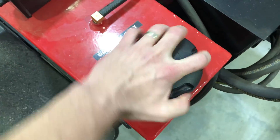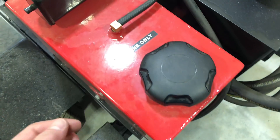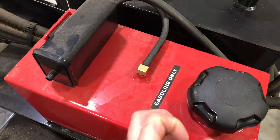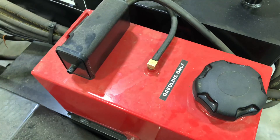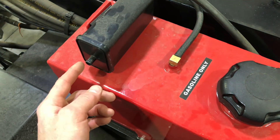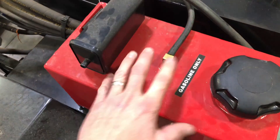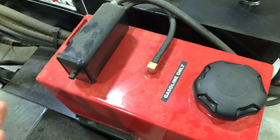When you fill this one, don't quite do it like a car because it's got a big fill area, so gas vapors can come out of there. On a car it's more of a plug flow through a small hole. So if this can't vent — this is where it's venting to the atmosphere — if this can't vent, it's going to push the tank up and click your nozzle off.